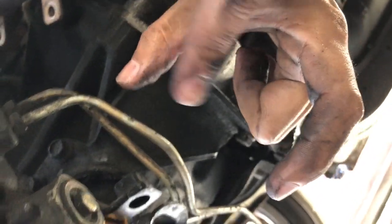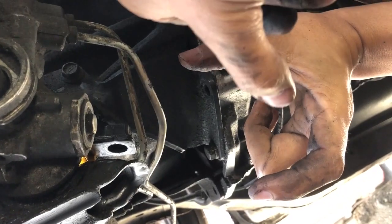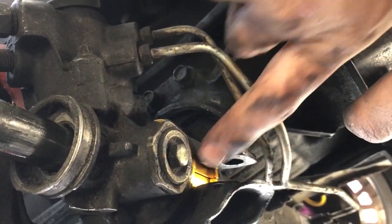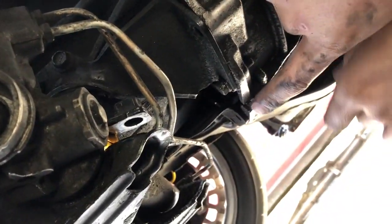The reason for that is these push the steering rack forward — I want to say like a quarter inch, if that — so you get more angle out of your knuckle setup. Make sure that C-shape is facing that way. We'll show you guys on the next one what I mean by that.